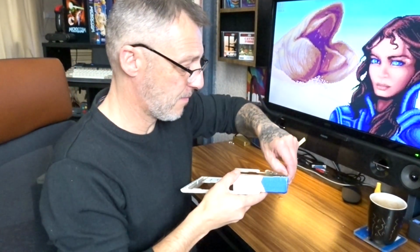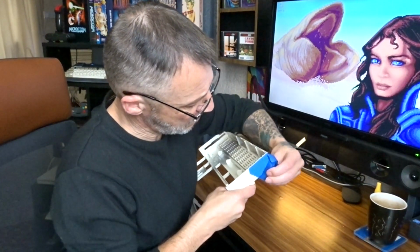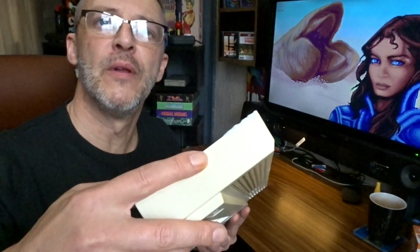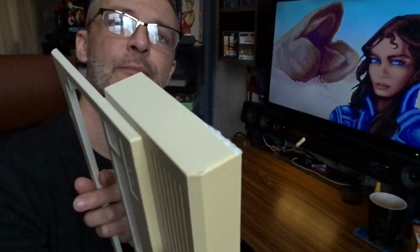Right, so now you've done that, you can take your tape off. That's how quick it sets. So then it looks like that, but you see the ridge. What we've just done is higher than the ridge itself, so that'll let us sand that down now, smooth. That's what we filled in.